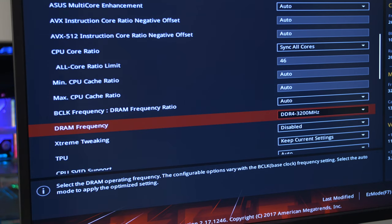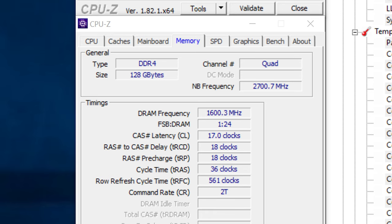I didn't really see a need to overclock our memory. 3,200 MHz is already pretty fast, especially for an Intel platform. You don't really need to push the megahertz that high with DDR4 for additional gaming performance — that works more closely with Ryzen and the Infinity Fabric, but Intel, not so much. I just aimed for our rated speed of 3,200 MHz. I went to the UEFI, selected the 3,200 MHz profile, and on the next boot it was operating at that rated speed. No problems.